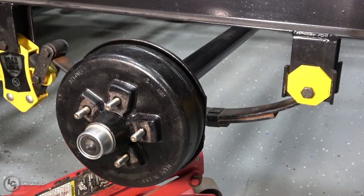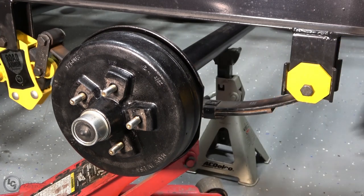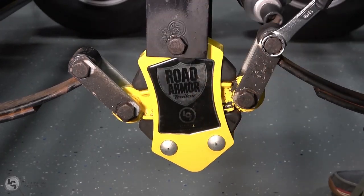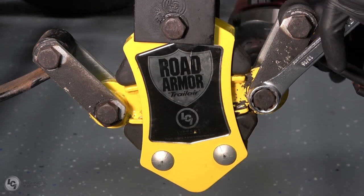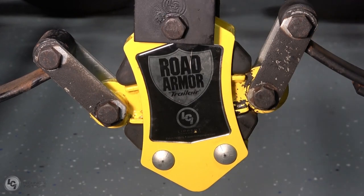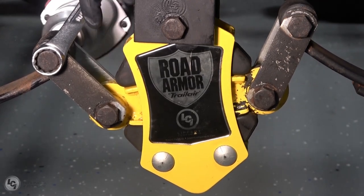Using a floor jack, lift the axle by the tie plate gently and support with a jack stand. Using a wrench and impact, we will now begin removing the shackles. Place the wrench on the head of each bolt to prevent it from spinning and wallowing out the shackle or hanger holes. Using your impact, remove each nut from the back side of each bolt. Keep the nuts handy as they can be used to protect the threads if you need to tap a stubborn bolt out later.